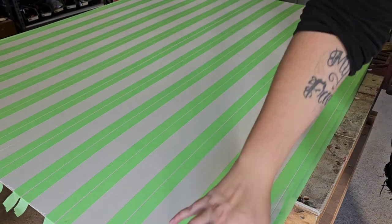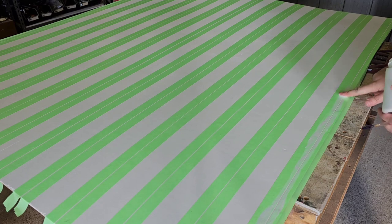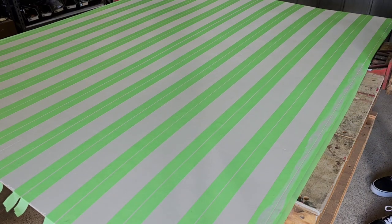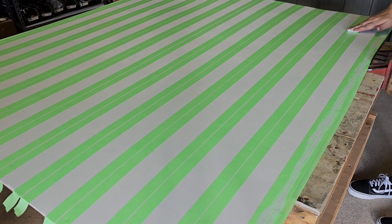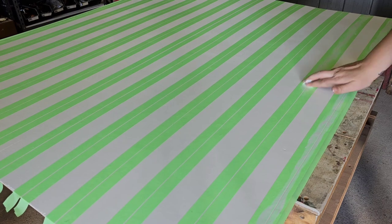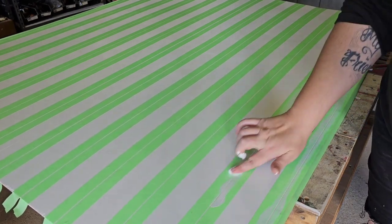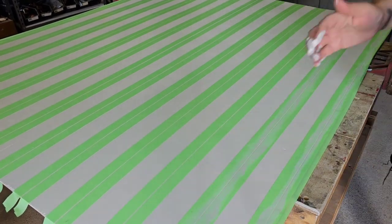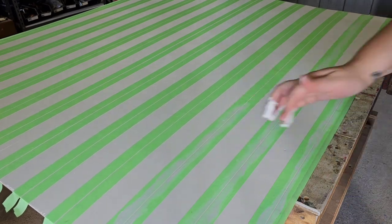As is customary when dealing with tape and painting, I'm running some white paint over the tape edge first. I'm doing this so that the paint will go under any tape where bleed-through might happen, and that way when I go in with my main color, that won't be what bleeds under the tape. You can also do this using clear coat, but I only do that if there's clear coat under the tape — otherwise when you take the tape off, if any of the clear coat has gotten underneath the tape edge you can see a difference in sheen.